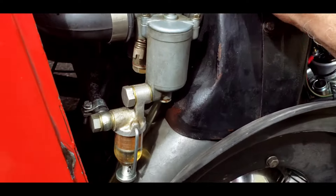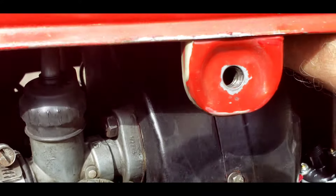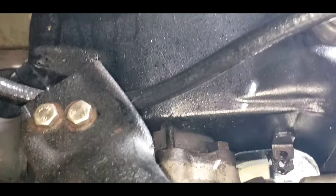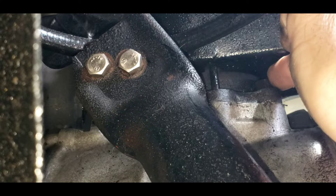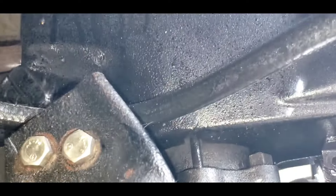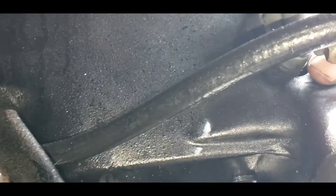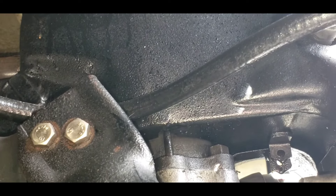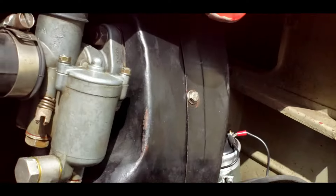And it's not just loose — it's broken. I'm wiggling the top of the engine, and if I shine my light up in here, the cylinder base nuts are loose — right here. I was like, well, that's strange, I'll just tighten those up. But look at this — grabbing onto the engine shroud and wiggling it — not only is it loose, the whole cylinder is cracked off. The ears of the cylinder are completely cracked all the way around.